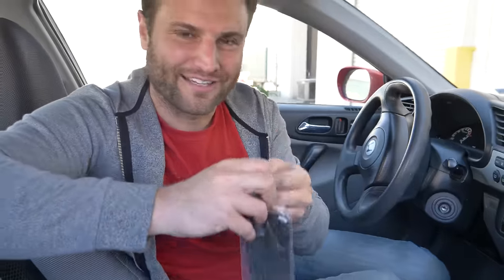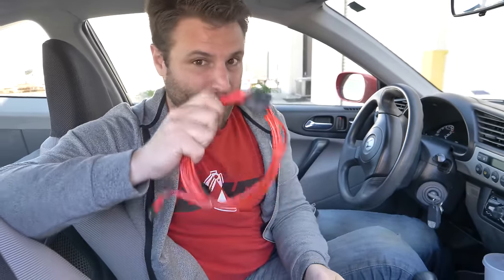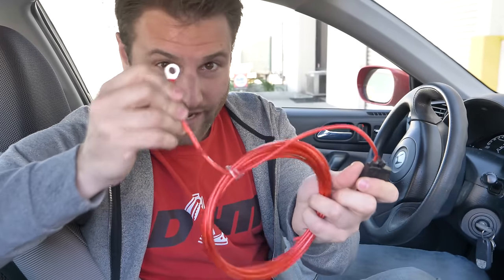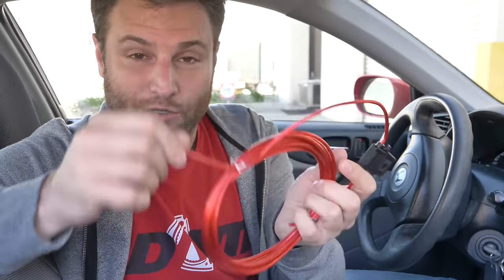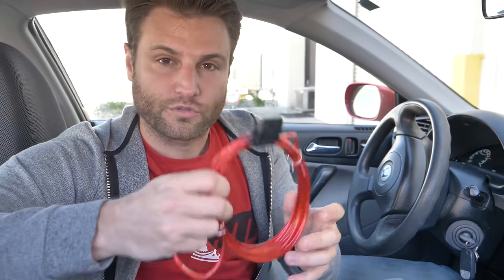While I want to make this video as cheap as possible, there's one thing I will not mess around with. At least this section of the wire — this is the positive coming off the battery or the alternator charge line. There's a fuse right here. If you do not have the fuse close to the power source, you will do very bad things to your car when you eventually ground it out or do something bad.